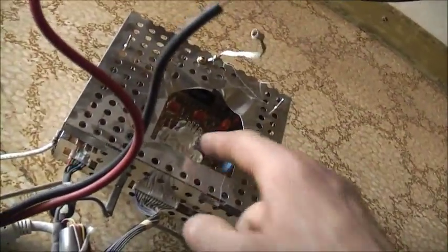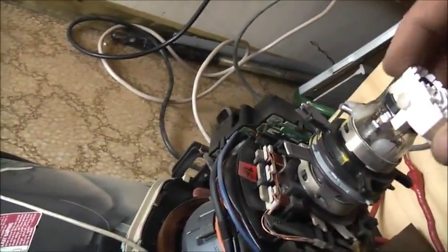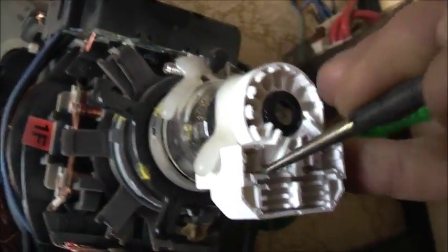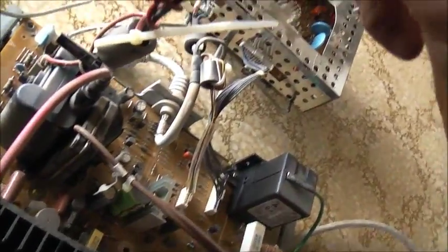If this can't be clipped off, you can easily undo it with a screwdriver — unclip that front half off the back half, and then get to those clips I just showed, because they just bend back. The edges of those clips hold the wires in, and when you pull them, it bites in and grabs like that. So it's a better way of getting the flyback salvage complete and untouched.